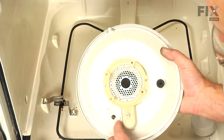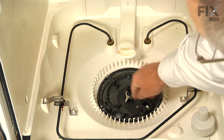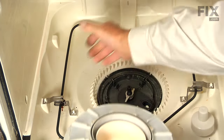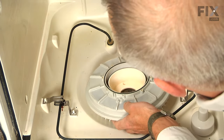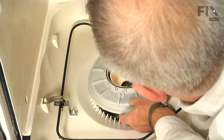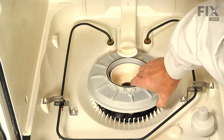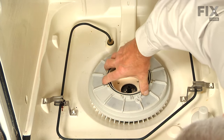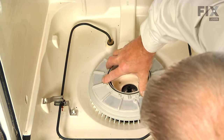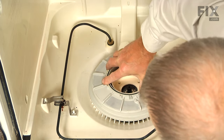If we look at the bottom of the separator, you'll see there is an oval opening that is going to sit right on top of that little gasket that we put in place. Line it up roughly, then we're going to lift up on that rear manifold, slide it over top of the drain impeller, drop it down into position, and rotate it until we have the separator lined up with the screw holes and the opening on that pump.